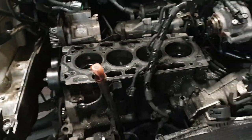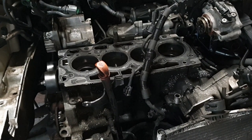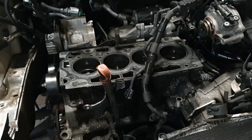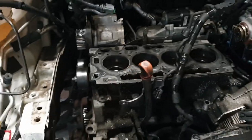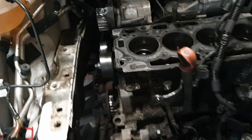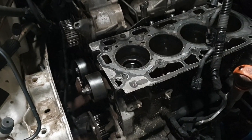Well, usually me. So, I'll put some head bolts back in. It really needs to support the weight of the engine. It's not to seal the head down. With the old gasket still in place. And then put the engine mount back on and go up in the air, drain the oil. Which I was going to do, I picked up a filter for it earlier, so I was going to do the oil filter anyway. But I was hoping to get away without taking a sump off. But things are sent to try us.